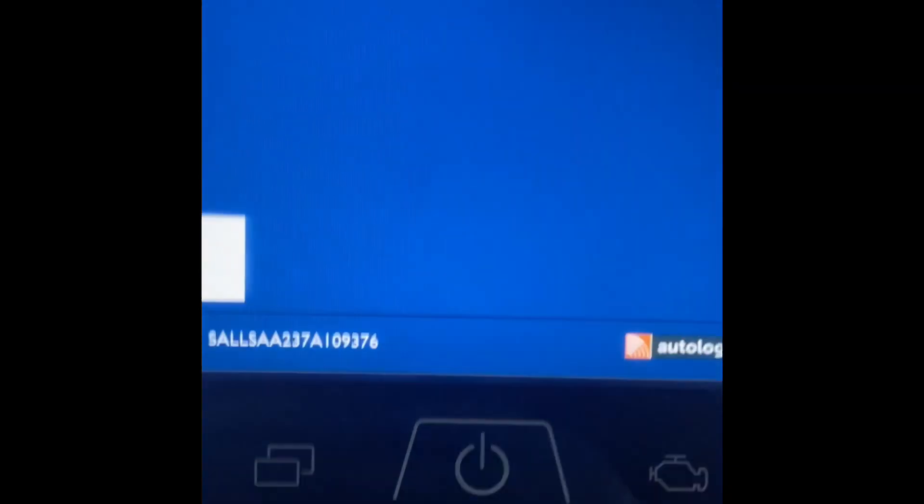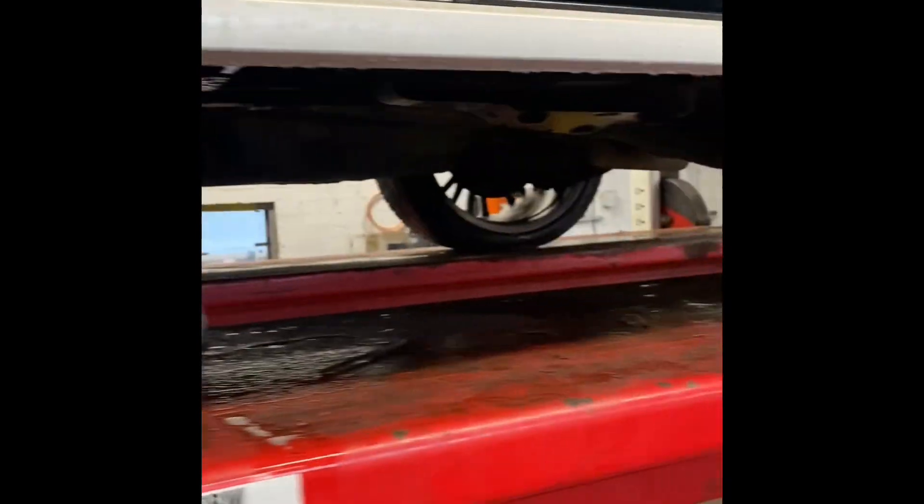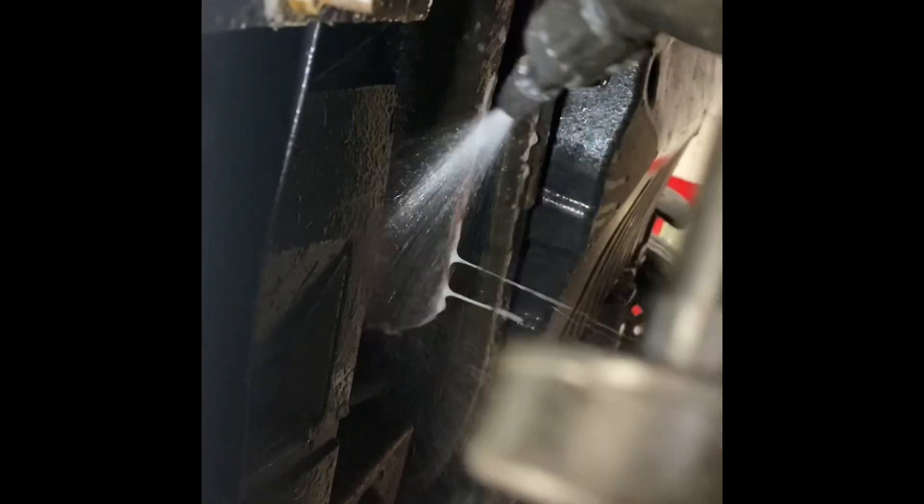What I'll do is have a look for a leak. You basically want to be looking at the suspension — I think it's further down on this front side. This is the reservoir here; you can see it's quite rusty. You basically want to get some soapy water while it's running and spray it — any leaks will show up as bubbling. Same on this side — there's a lot of rust here, seam up there.